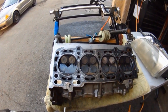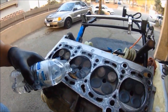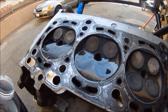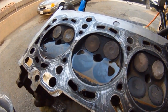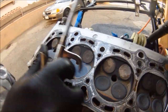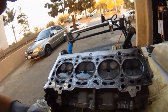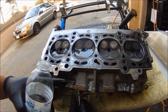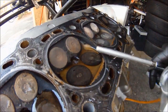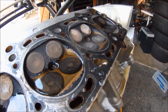So we're all good on that valve right there. This one's leaking, so we've got to grind that one. Okay, next — fill it up. We got them underwater, ready. I'm hitting this one right here — it's good. I got the nozzle right behind the valve, this is 125 to 130 psi coming out of this nozzle. We're all good right there. Now this one — make sure the valve is completely under the water. I usually use soap sometimes but I want to see exactly where the leaks are. We're all good.